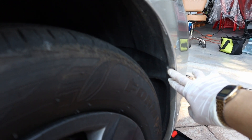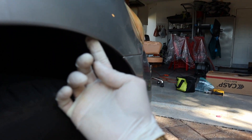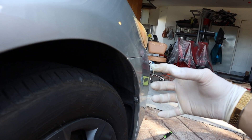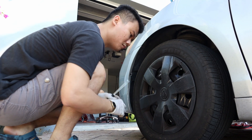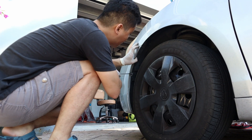We need to remove the plastic retaining pins on the left and right hand side. There's also a bolt behind the fender cover — we'll get into that later. After you remove those, it will be easy to pull out the bumper. To remove a plastic retaining pin, just use a flathead screwdriver and turn it clockwise — it comes right out.